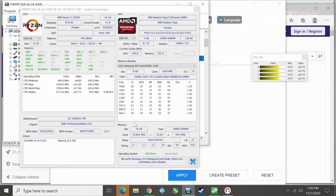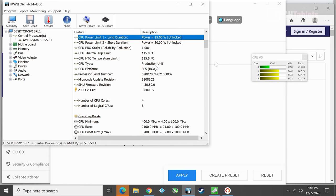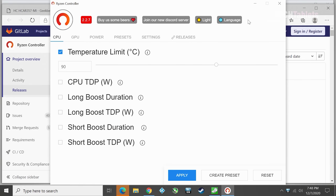The RAM running in dual channel works fine as established in the full review, but the BIOS won't run it any faster. What I'm interested in is boosting the power limit for better performance. They have actually toned this down - the power limit one is set to 25 watts and the boost limit is 30 watts. They could have gone higher. That's why thermals and fan noise are so good in my original review. But this comes at a risk to longevity of parts and VRM stress, so be careful.